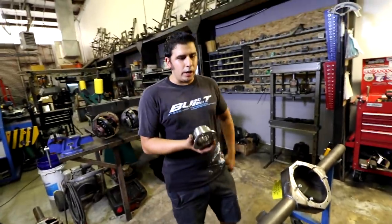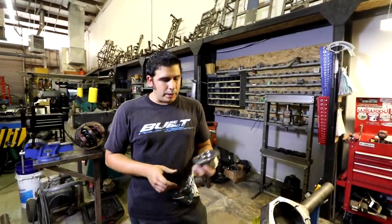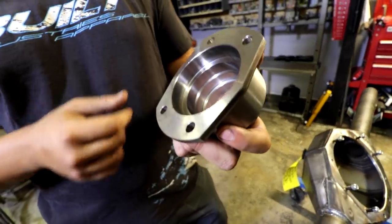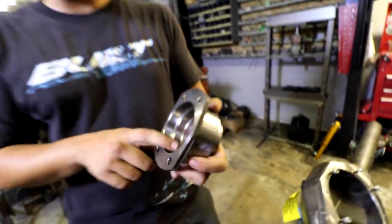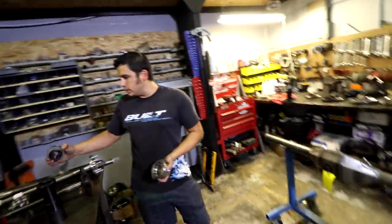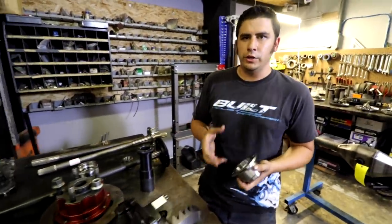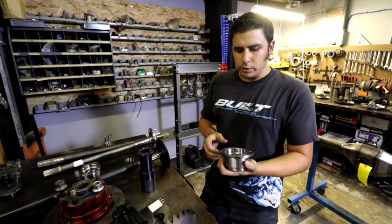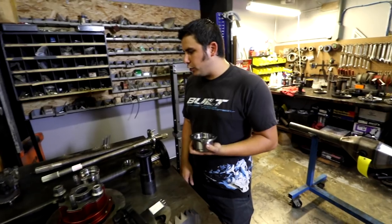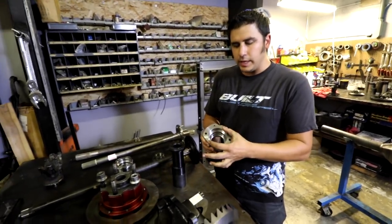Okay. So what people talk about when you go to the junkyard is getting a big bearing housing. Typically what they refer to is this bearing diameter. I believe it's a 3.150 diameter bearing, and it'll accept the set 20, which is like the most common for your aftermarket housings, is these set 20 bearings. The other bearings are going to be smaller roller bearing, and they're not good for side load and abuse. So if you're going to go grab a housing from the junkyard, you want to make sure you get what's called a big bearing housing, and you'll note it by this diameter.